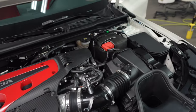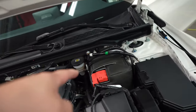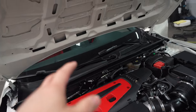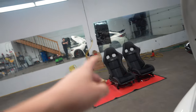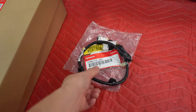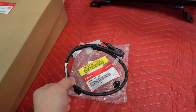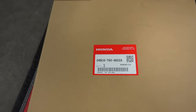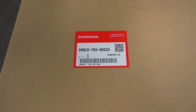Since we're dealing with airbags, we're going to disconnect the battery. And while we let all the energy discharge, we're going to go ahead and mount the seatbelts onto the seat rails. Here's the part number for the harness you need for the driver's side, and here's the part number for the seatbelts if you guys want to go my route.